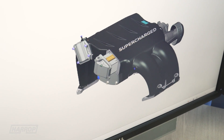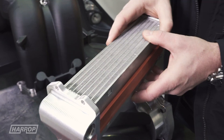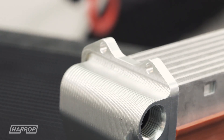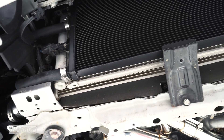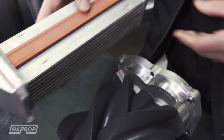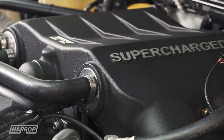Moving to the intercooler system, using the latest core configuration technology for thermal efficiency, the cores are dual pass and integrated into the manifold casting, further enhancing heat rejection capabilities by providing cooler, denser air to the engine to generate more power and torque. The front mount radiator features a similar louvred fin and extruded thin tube configuration with a dual pass system. There is no reservoir used — fill and bleeding is done via the rear intercooler caps. We supply a large Bosch intercooler pump for the closed air-to-water circuit, connected using moulded hoses.